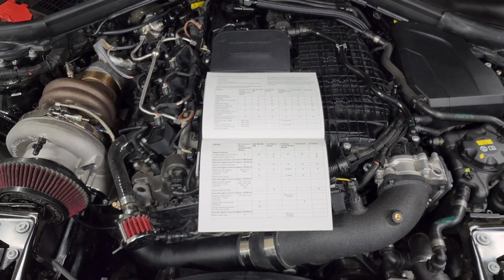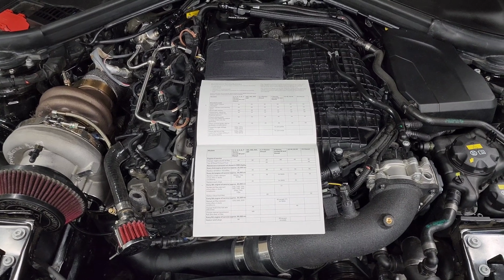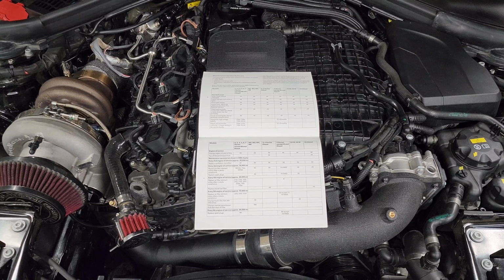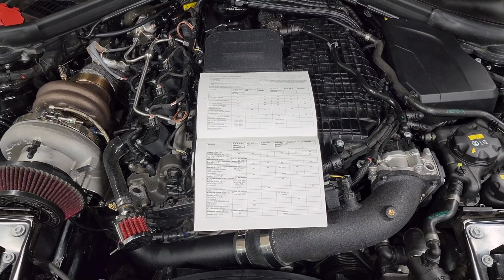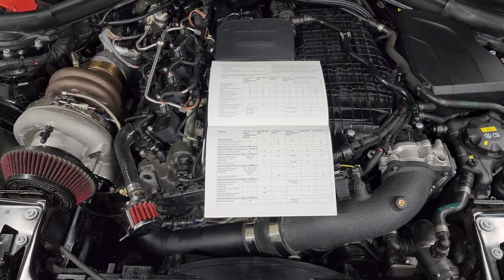I know some people, like I said, have reduced it to 30 to 40,000 miles because they're running really high boost pressure and stuff that just puts a lot of wear on the plugs. And if you leave them at stock gap, that wear will actually increase the gap even more and cause it to start to misfire. So that's something you just want to pay attention to. And if it's worn down, replace it.